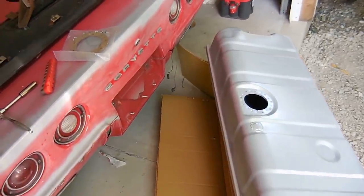He has the gas tank straps and we'll go from there. Before we go putting the tank up in here, there's a couple lines in place - there's a vent line up in here, there's the main fuel feed line right there, and another vent hose right there. Luckily this car came with a bunch of hose so we can replace those fairly quickly. That way when we put the tank in it won't be that big of a problem.